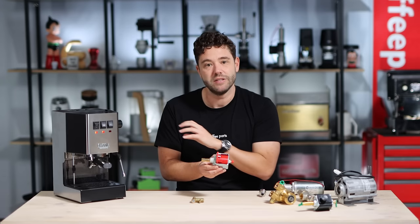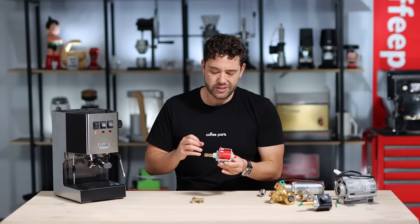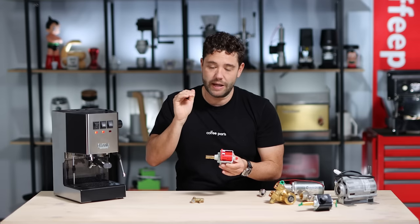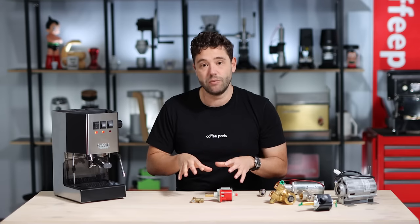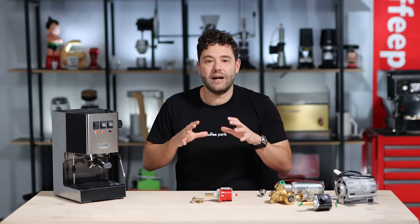These pumps are small, so they really fit into smaller domestic machines. They run only from a tank — you can't feed them in with line pressure — and they're less susceptible to limescale build-up. They're great for entry-level home machines, but they are a bit noisy. They also take a little bit longer to ramp up to pressure compared to a rotary pump. And once they get up to pressure, because it's pulsating, that pressure is sort of vibrating, so it's not a perfect eight or nine bars. That said, they're super affordable, tend to last four or five years, and they're a really good option. Example machines include the Gaggia Classic, Rancilio Silvia, Rocket Appartamento — that kind of machine, from entry level up to where machines really start to skyrocket in performance.